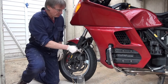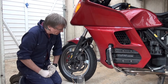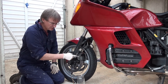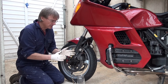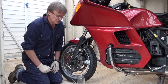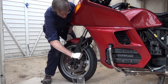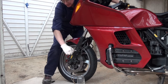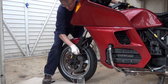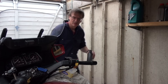So I'm working on the second side. I've taken the rubber cover off the bleed nipple and fitted my plastic pipe over the top — it needs to be a really tight fit. I'm going to give it a couple of pumps just to get fluid into the pipe leading down to this caliper, then push back the pistons the same way as last time to get the fluid from the pistons back up to the bleed nipple, then finish off by clearing that out as well. It's slightly tricky because you're working on opposite sides of the bike, but we open up the nipple — probably a good idea to keep the spanner on the nipple — push in, close. So that's the front done.